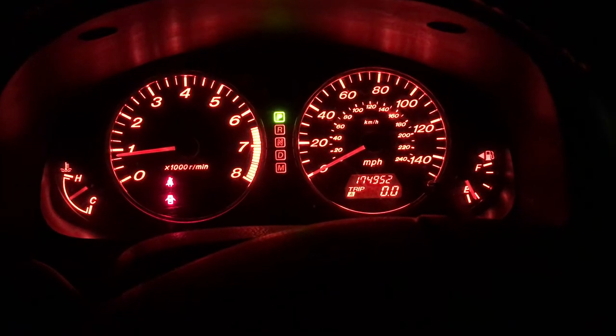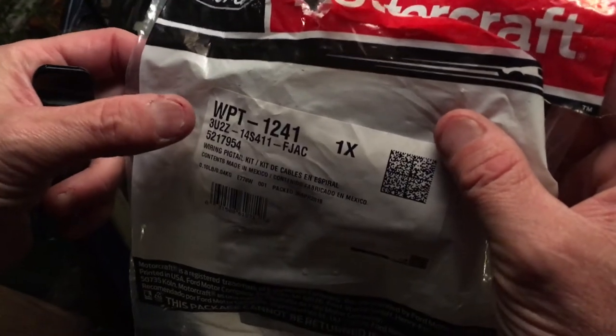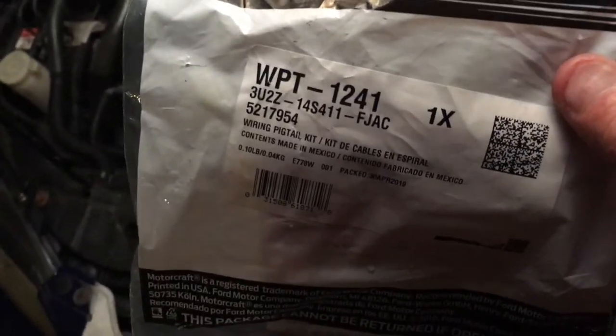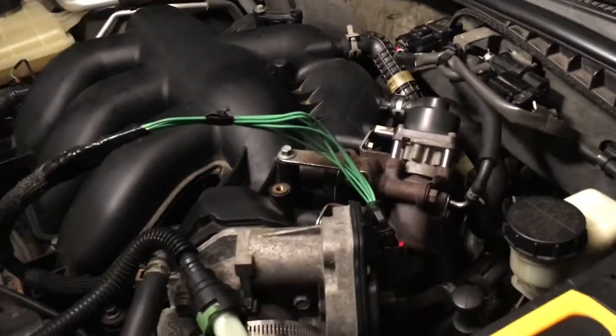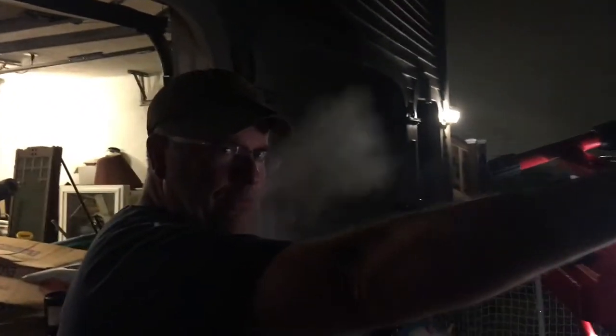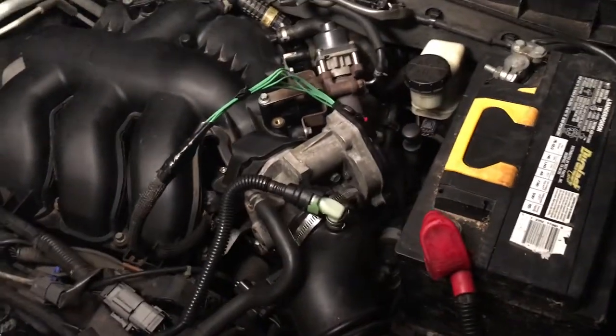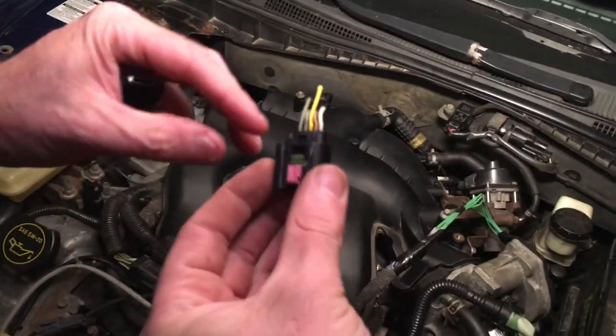I'm gonna kill it. So that's it — it's not running right but it's consistently not running right. It's been a long, stressful, tedious journey. I can show you the fix: WPT1241 on Amazon for under 30 bucks — a wiring pigtail kit. Thanks to my older brother — he was double-checking my work by pulling on different harnesses, and one of the six pulled out, which was one of the power lines.